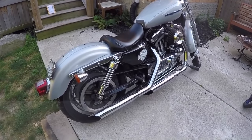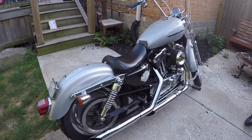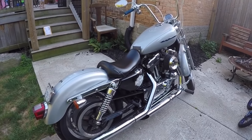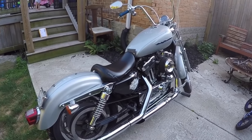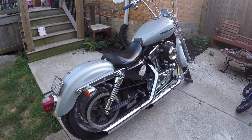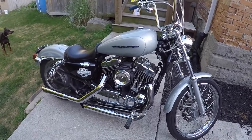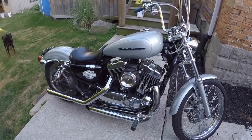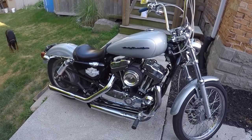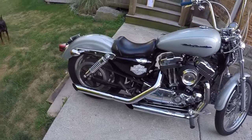Hello YouTube, just doing a video on my Sportster. I got some new DK Customs TTI Thunder Torque inserts. I'm gonna let you listen to how it sounds before. I got the Cycle Shack exhaust slip-ons, and last week or so I modded them by drilling out the baffles a little larger. It sounds okay but I think that caused me to lose a little bottom end, so I'm hoping the TTIs will help — or at least not make it any worse. If putting them in by themselves doesn't work, I'll probably add the baffles back in with the inserts.